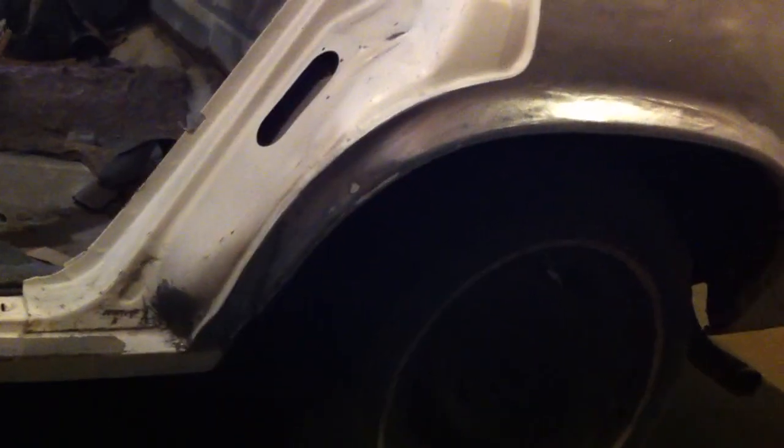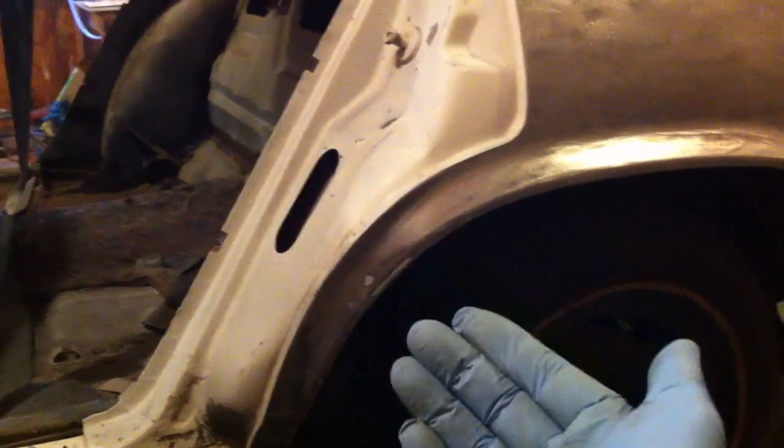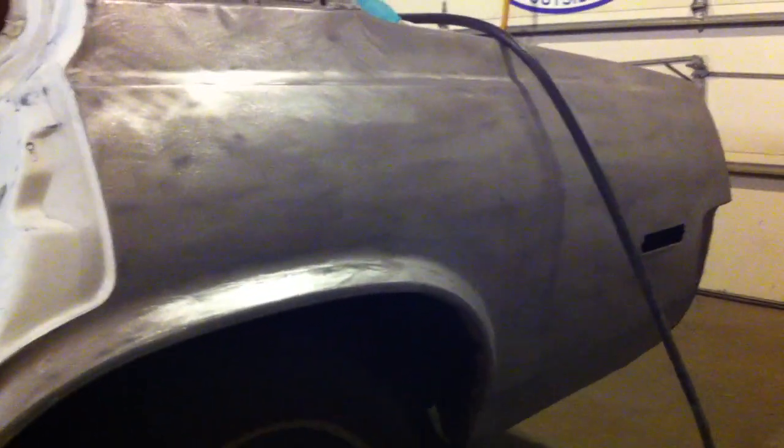The quarter panel is stripped where etch is going to go. I just need to do some metal work here. I've got my metal working hammer — it's a converted claw hammer, the face is ground flat, and a slide pin. Just going to try to work that fender. You can really see how it's deformed from this angle. I'm not going to be able to fix that only with filler. I at least have to fix this profile and get that tucked in there a bit more. That's all DA work — letting the compressor cool off while I do some manual labor. I do use power tools — a DA — like other people.